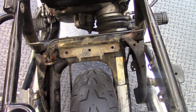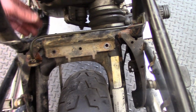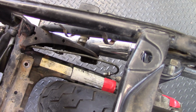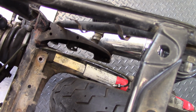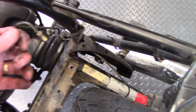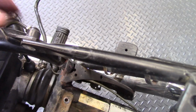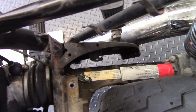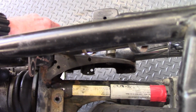There's a certain dance to getting the rear steel brake line out, so I thought I'd try to show how I did that. If I rotate it up, that's part of the trick, and then the other part is to get the part that's at the back that went into the master cylinder to come up over the swing arm. Then you can roll this over and you can get the fitting to slide outside the frame. Now you can roll it a little more and extract the bottom and then kind of loop it around and it pops out. So like I said, a certain dance.